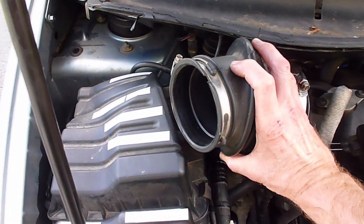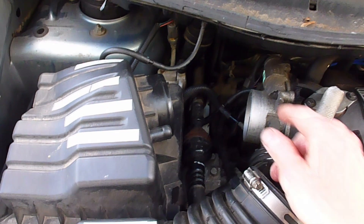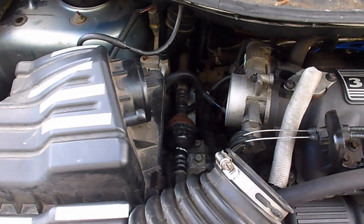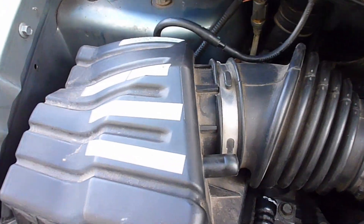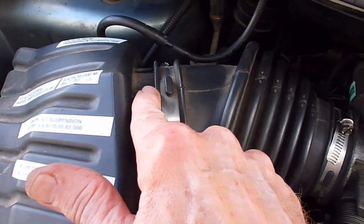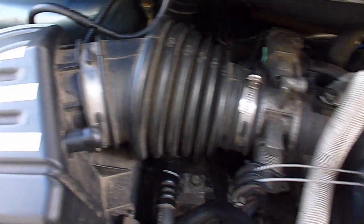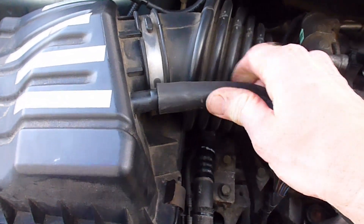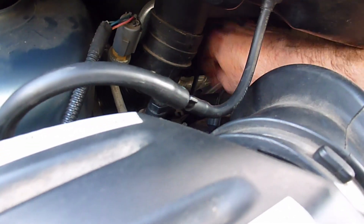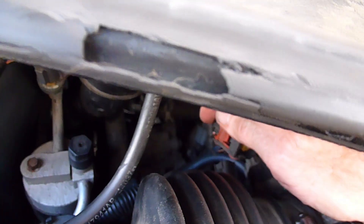Now you will squeeze your crossover pipe. I always go first onto the air intake and then secondly onto the housing — I just find that easier. You're going to notice there's a little notch on your crossover pipe that will line up with that pin right there. After that, you're going to tighten down your two clamps — snug, don't kill them, don't strip them out. Then you're going to take your breather hose from your valve cover and hook that back up.